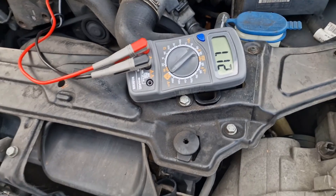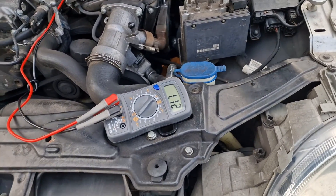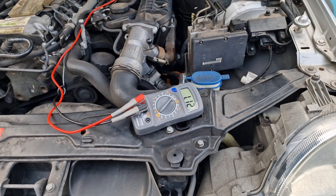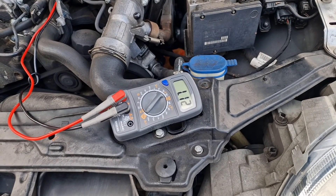So guys, with the drain being like 14 amps, it broke my new multi — this one's just got a piece of wire going across the fuse, so this one's due to blow up at any stage. But I've disconnected the diesel heater — it's a water heater, it heats the water up — it's underneath the car, just above the starter motor, and I lost a massive amount of the drain.